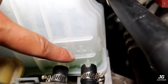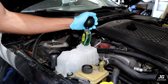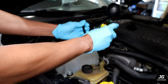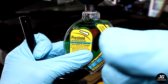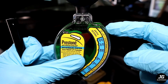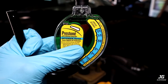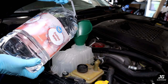You can see that the coolant level has dropped so we need to top it off again. I'm going to test the coolant so we know if we need to add more coolant concentrate or just distilled water. When using this tester there may be bubbles around the needle which can give wrong readings, so just tap on the glass to dislodge the bubbles. You want to be at negative 37 degrees Celsius for 50-50, but I'm going for 55-45 and the needle is slightly too high, so I'm just going to top it off with distilled water and recheck.